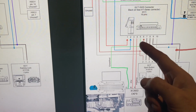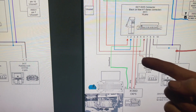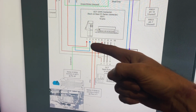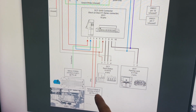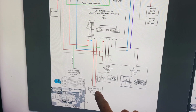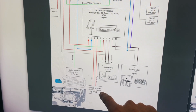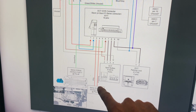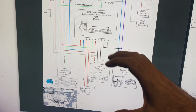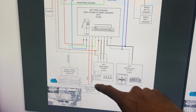Now, the other thing that I changed, which is because I am MSD80 originally, the original AJL wiring, he splices pin 3 and 4, which is the PT CAN bus. He splices that into this connector down here, X10545 and X10546. Again, if you're on new TIS, it shows where they are. Now, I guess it's going to be all vehicles. That is in the wiring harness right on the firewall, and it's the main wiring harness, which is fat. Like, I don't know, probably 50 wires in there all taped up, and I didn't want to pull that apart.